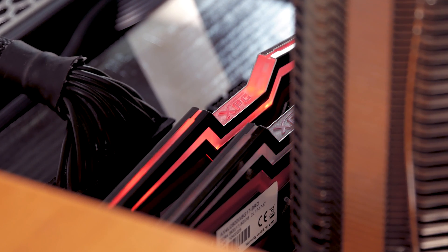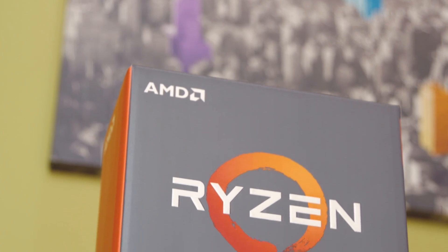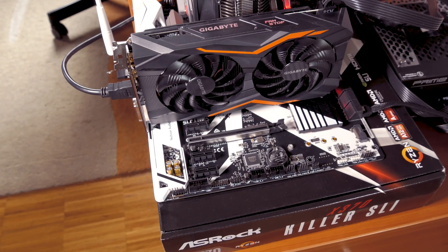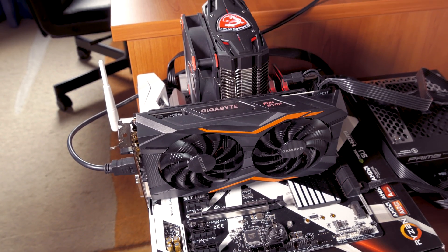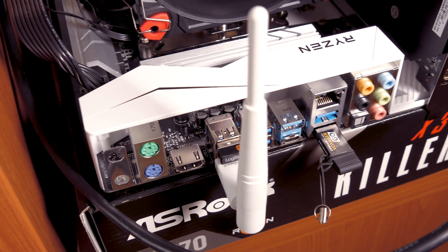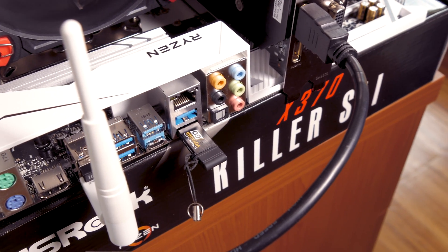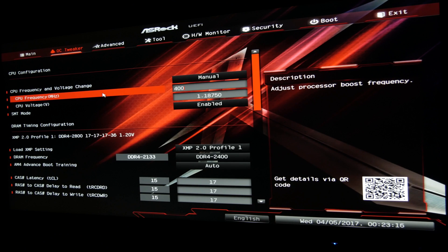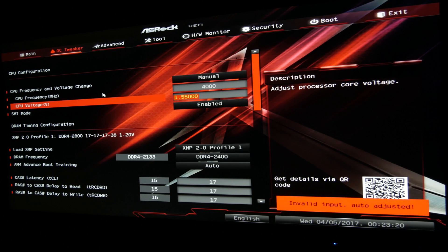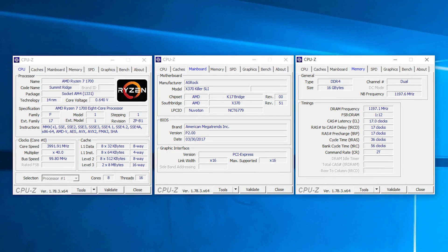Speaking of RAM speed, although I used a 2800 MHz RAM kit coupled with the Ryzen 7 1700 CPU, I was actually far from reaching that frequency at that time as the XMP profile just wouldn't work even with custom settings. I sat on that at the time, as I benchmarked this motherboard about a month ago, and in the meantime it received a new BIOS update, so it's possible that memory compatibility is now much better. Despite that, I easily managed to get a 4 GHz overclock with just a bit above 1.4 volts on the cores for my sample, with RAM speed set at 2400 MHz.